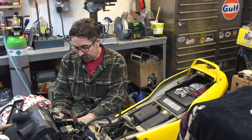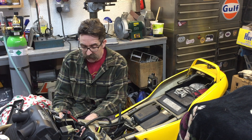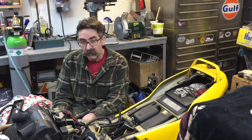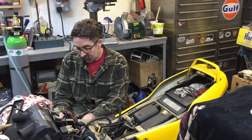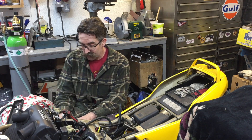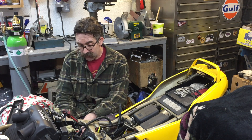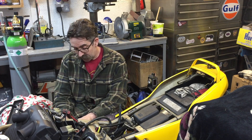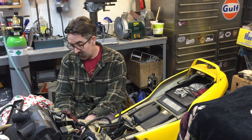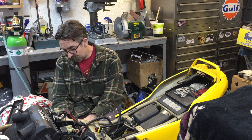The first thing I've done with it was to change the cam belts. There's a bit of mystique about changing cam belts on Ducatis. I'm not sure about the four valves, but the old two valve engines — it's not difficult, it's not rocket science. As long as you follow all the timing marks, get them all lined up, change your belts, do your tensions, and check that they all line up again when you turn the engine over a few times. You know, you can't go wrong really.